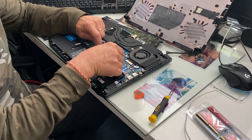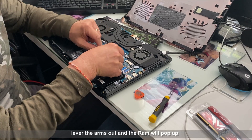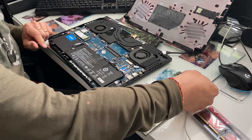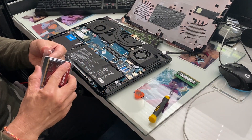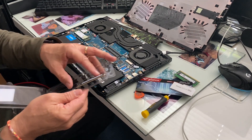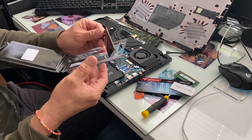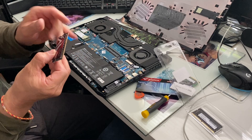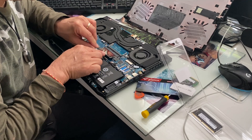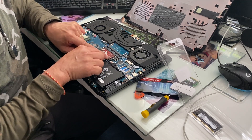Now the RAM here — I'll do this myself again. Just grab the two sides and pry it open, it should pop out. Just take it out. Get the new one. When you're touching these, try not to handle the contacts because copper and sweat — just pop it in like this, push it down.